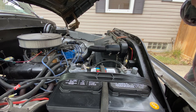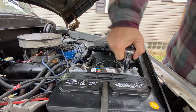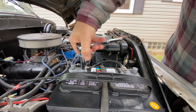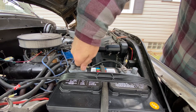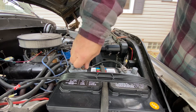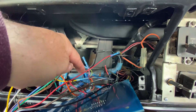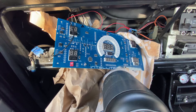This should go without saying but don't do this with the battery on. I put the battery on to test the power, but I'm going to take it right back off. Don't do any of this stuff with the battery on — you might get a short and next thing you know you've fried a $400 instrument cluster. I've got the power on there; one wire left and that's the ground.